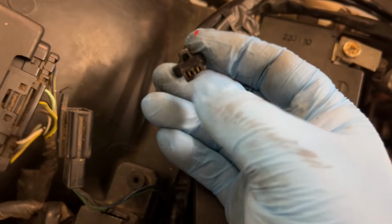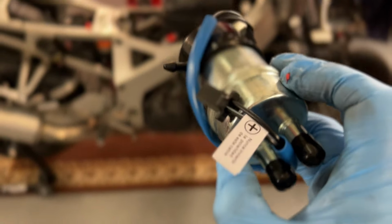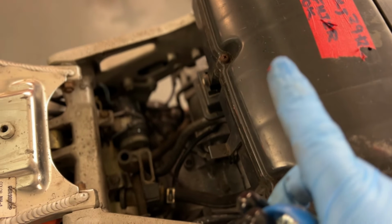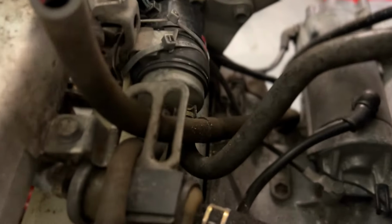So I was power probing the fuel pump, and that was like, brr, brr, oh, I'm going to die now, and it died. So that was good. And as if out of nowhere, pow, here's a brand new aftermarket pump. So what I know is, from owners, they've told me that if you have up to half a tank and above, there's enough gravity to fill the float bowls. But under half a tank, you're not going to be able to do it. And fascinating as that might be, I don't really want to be pressuring. I'm going to replace all of this with a new pump, but also new fuel lines as well.